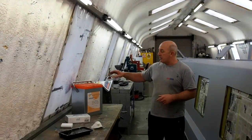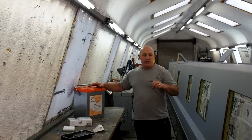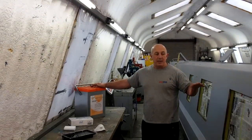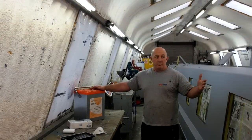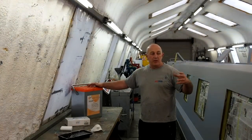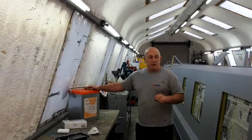We do use brushes, and you'll see that as we progress, but at this stage we don't need to be worrying too much about the finish. You can rub down between coats, flatten off, and get a smooth finish every time you coat, but there's no point until you get to the end of your undercoating stage because you're just removing product. Our idea is we're building product — four coats of primer, three coats of undercoat — we're going to build this product up so we've got a decent thickness, then we'll machine it back, just removing that surface layer for a flatter finish, then we can get a gloss on and hopefully it'll look good.